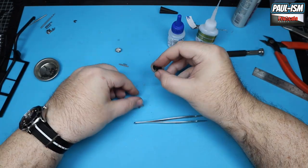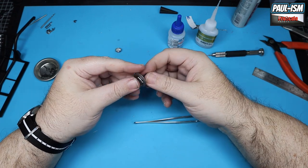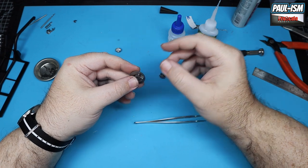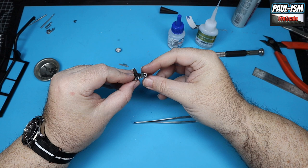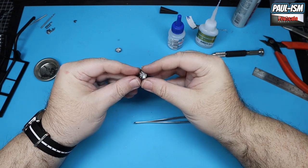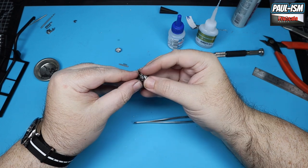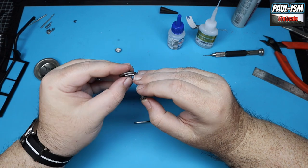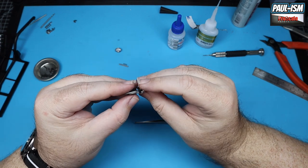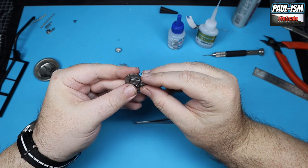There we go. And then onto our brakes. So there's our master hub that we did earlier. We've got the rear section that sits in the back with our caliper carrier there. The caliper slots over the disc. It's a very tight fit, which is quite good, to be honest. And then there's two locating points on that carrier at the back as well. So they've all been drilled out previously. And again, I found they need to drill out a little bit wider than recommended.